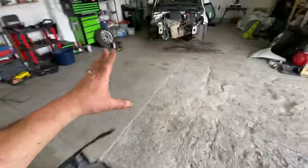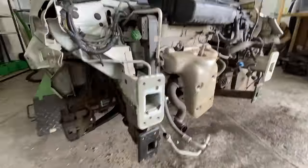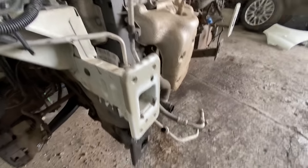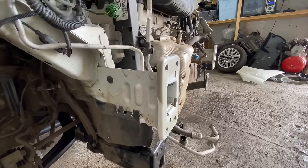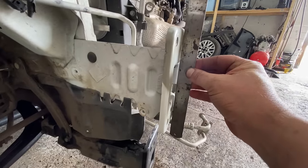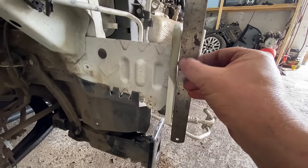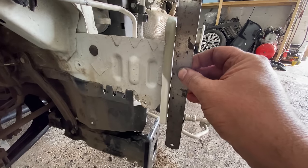The other thing, we have actually pulled this chassis leg out now. That is all straightened up. You didn't want to be on camera, so I couldn't do any of the filming, but you can see that we haven't really whacked about at all. And we've used this straight edge to go across and bring it across here. The only thing that is left is a slight gap there. See that very slight gap? So I'm going to tap it from this side and just tap it there a little bit, and that should just knock that little gap out.